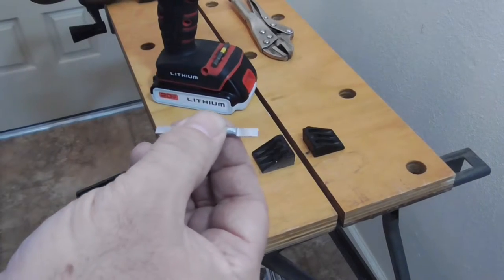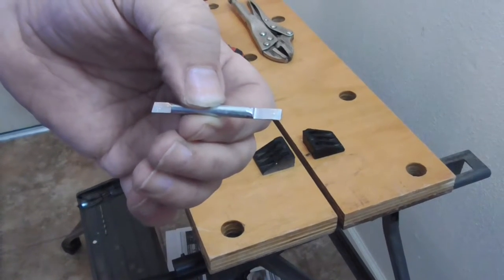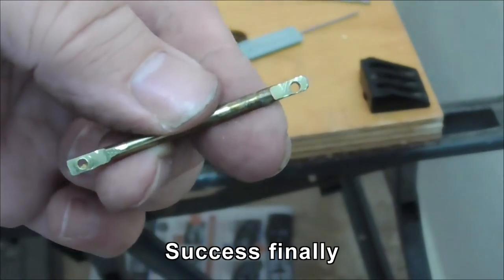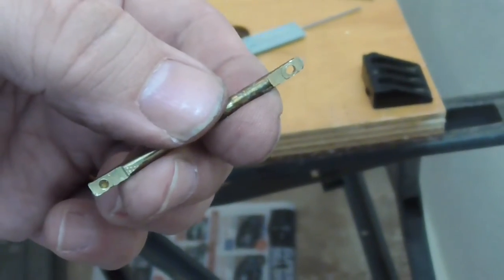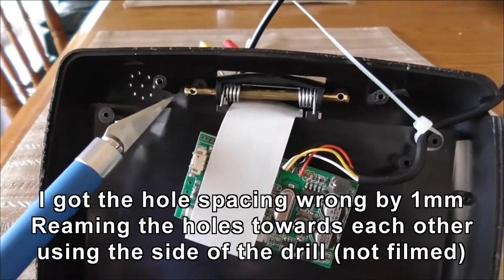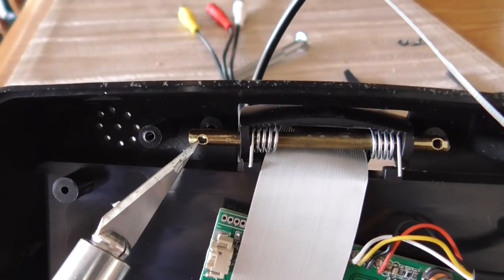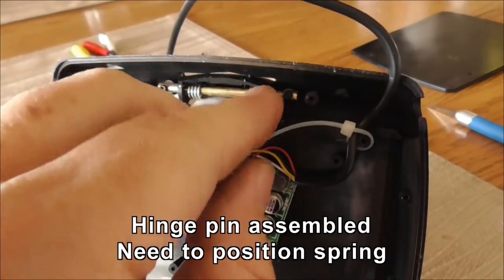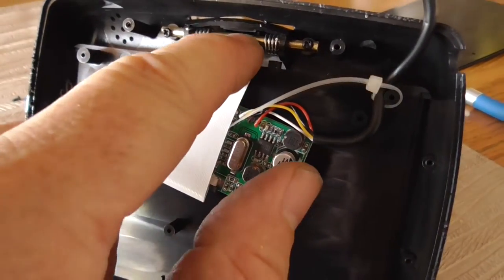Oh well - it's still going to be better than plastic. All that effort - good practice, now I'll do it on the brass one for real. I've got the brass piece done with two holes. Hopefully the hole spacing is right - let's see how it fits. Despite careful measuring, one hole is lined up but the other is off by about a millimeter, so I'll have to ream the holes a bit with the drill. I've got the screws in at quite a bit of an angle, and the spring back on. There was a catch behind it.